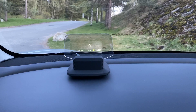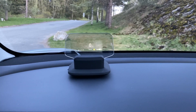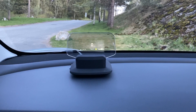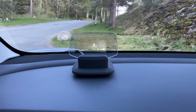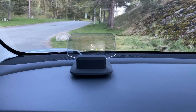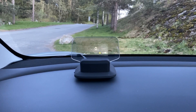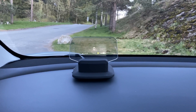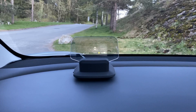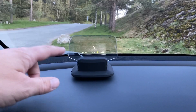As I mentioned, it's up there in the footwell on the passenger side — really easy to get to — and you just have to fish the cable on top of the center console under the dash. Connect that and everything is good to go. The second option is you can use the 12 volt from the center console. You have that cigar lighter socket — that is 12 volt. Go to any shop, buy an extender, cut the cable, and then solder or connect them together with this device.